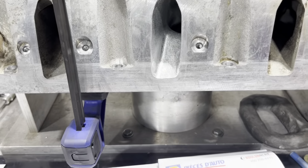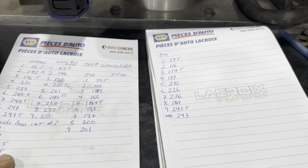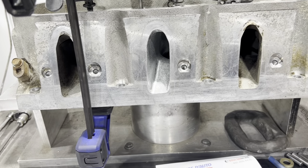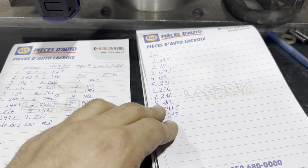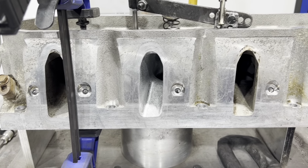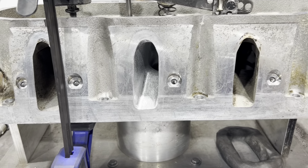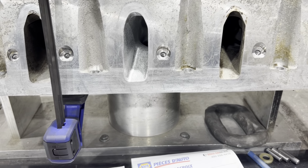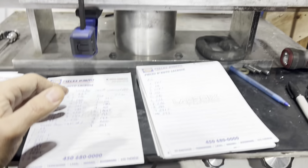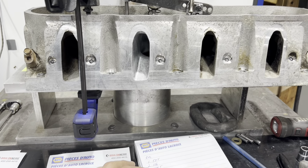The only thing that I'm going to try right now that I never tried before, to be honest, is a back cut on the intake valve, and see what that does, okay? I've never tried it on an LS cylinder head. We might lose, we might gain. It will be a good way to check. For the amount of work that I did to the exhaust port, the numbers are outstanding, okay? These heads are known to flow good when you work them on the exhaust.